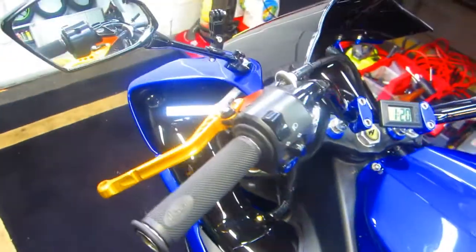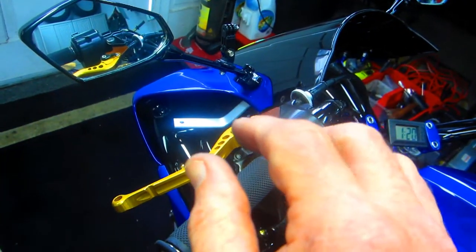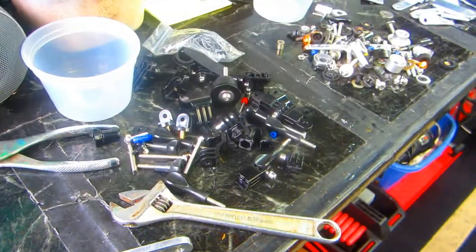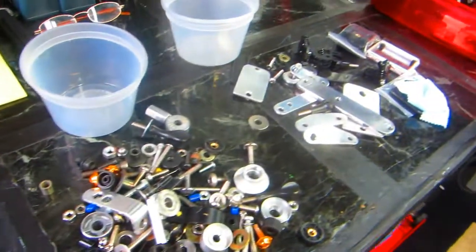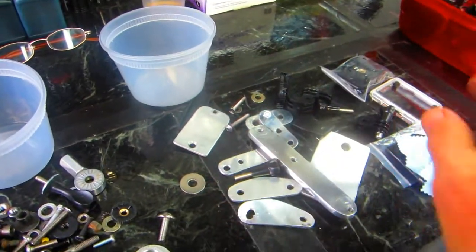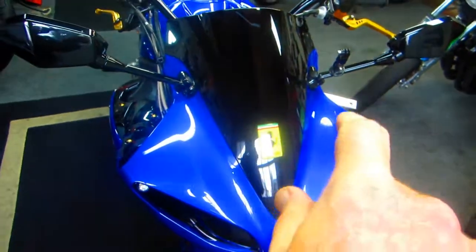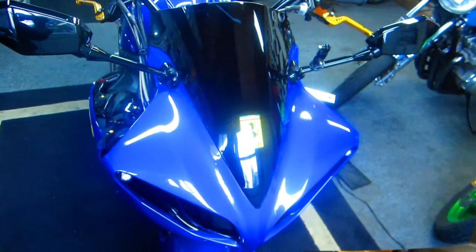It looks a lot easier than it is, but getting that bracket the right length and the right shape, easier to do it with 1/8 inch material and then just replicate it in 1/4 inch material. For people that might not know, back in our ongoing camera development, which there are about 50 videos, I showed how I made and polished all of these brackets. Not going to go over that redundantly, but anyway, all beside the point right now. I do have extra little parts to play with, and I'm really excited about. Now I'll go down and I'll replicate this in 1/4 inch, and I won't polish it until I get everything set exactly how I want.